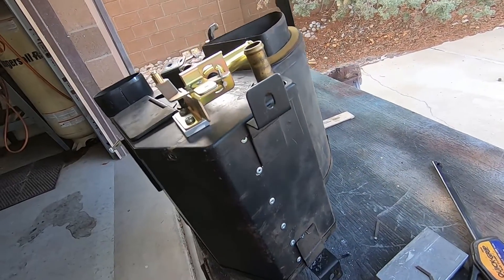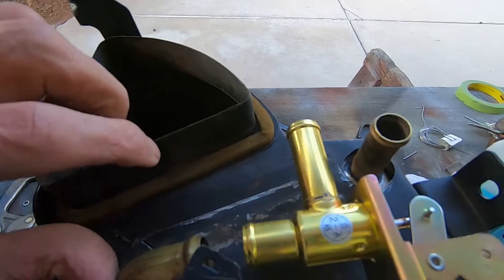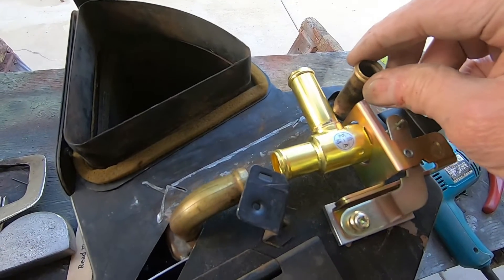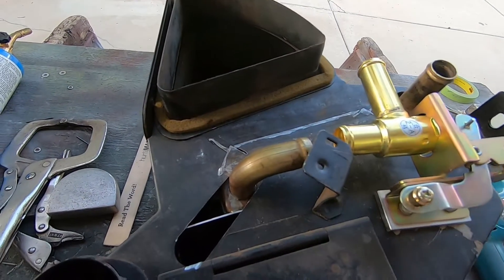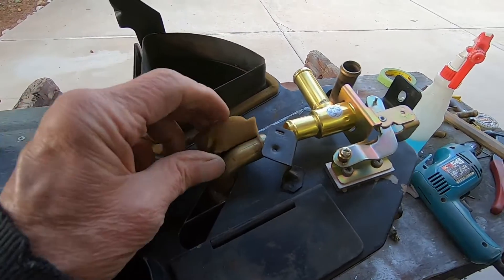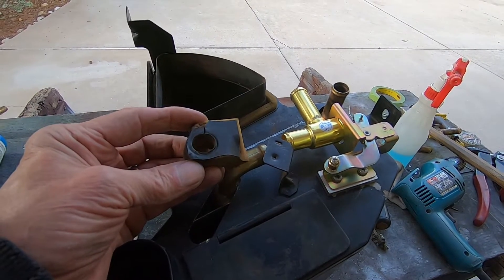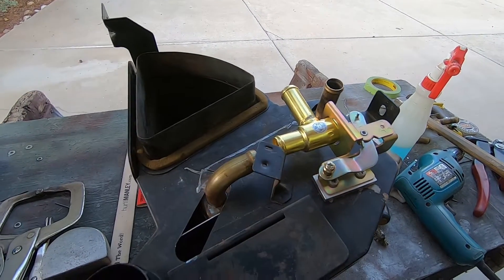I've got that piece all riveted in and I set this in place - this is going to be right where it's going to go. I'll be able to put my hose from here to here, no problem. This is where it was in the original position. So what I'll do now is just seal all the edges and across the top and bottom with something. What it had in the original core was just some foam rubber with some vinyl upholstery material across the edge, so I'll just do something similar - that'll hold it nice and snug and seal it all the way around.